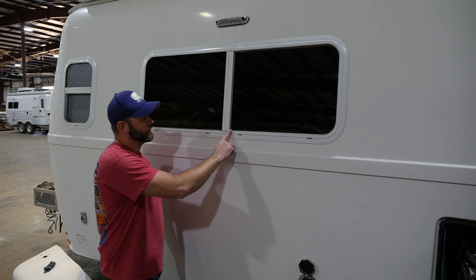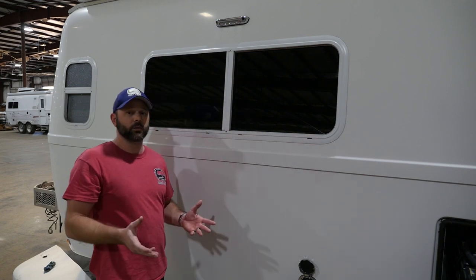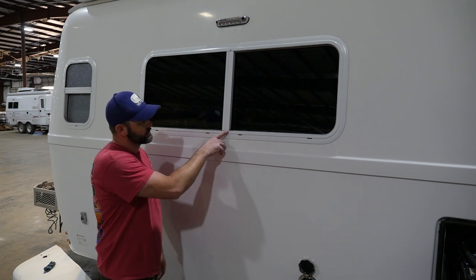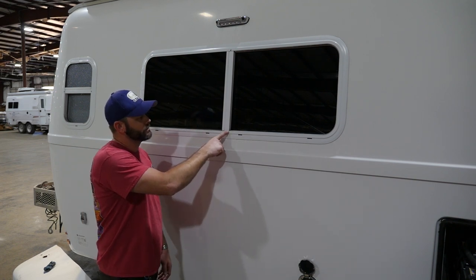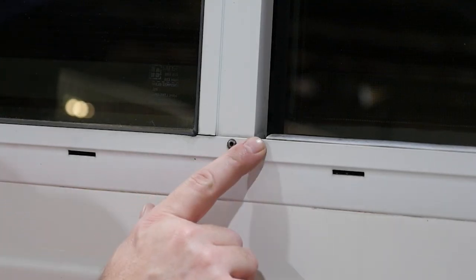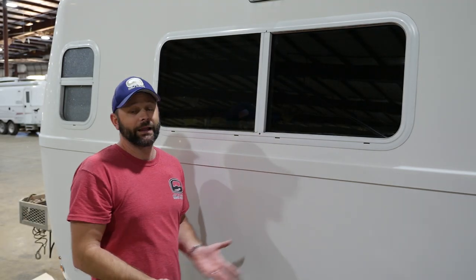Now the main thing with this — you'll notice a weather strip here. That weather strip does help to deflect a lot of the water off of the windows and away from the water track. If you look here, you'll notice that it is just a touch short on the window. This may happen over time — these may start to shrink a little bit. You can definitely replace them.